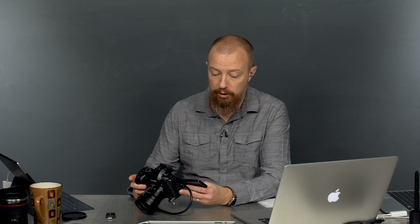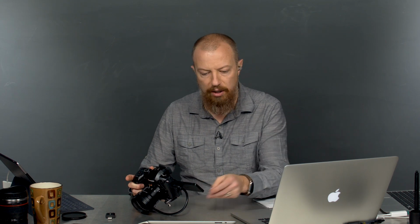However, if you're going to put a mechanical lens on there, like I was talking about, then you have to enable the feature to shoot without a lens. Say yes, because otherwise the camera thinks there's no lens, even though there is, and it doesn't take a picture. On the GH5, that option doesn't exist. It's just always on. They figure this is a pro camera, so it's just on. You can't even turn it off. But you can still change the focal length either when it boots up or inside of the camera settings.